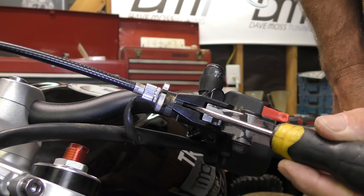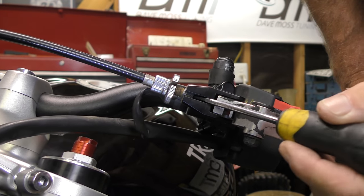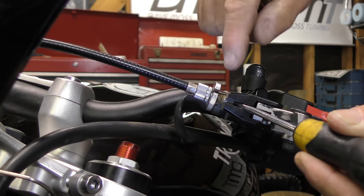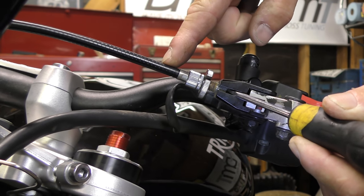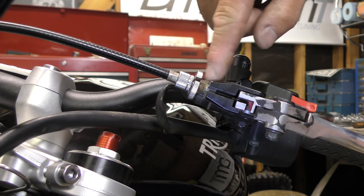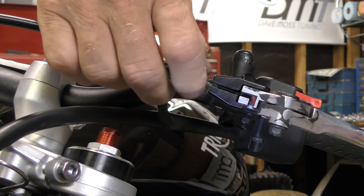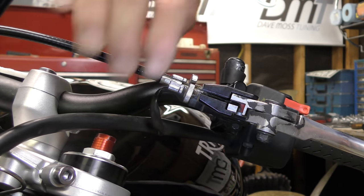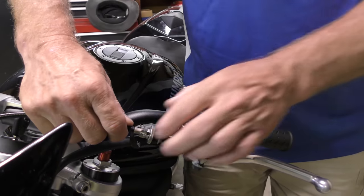What we're looking for is the end of the adjuster and a hard contact point — that hard contact point is here. We bring that forward and we only have a little bit of thread left. So it makes sense now to go to the other end of the clutch cable and make an adjustment there, so this adjuster can go back in and we're not stressing what is essentially a hollow tube. We need this in as much as possible.